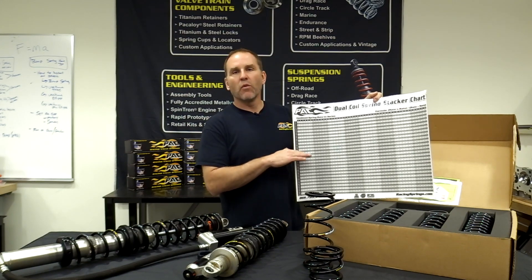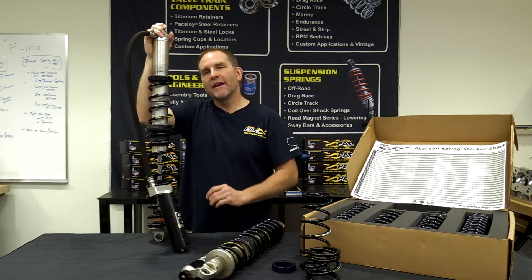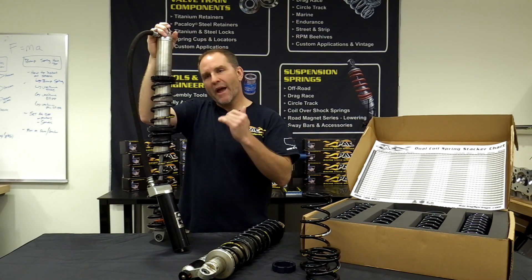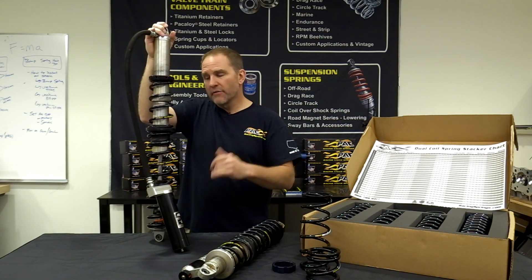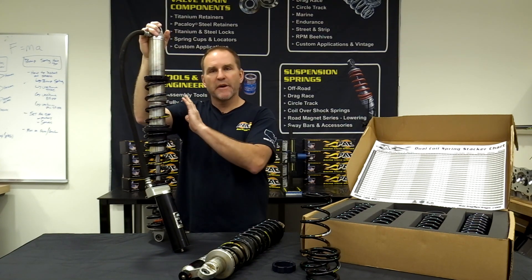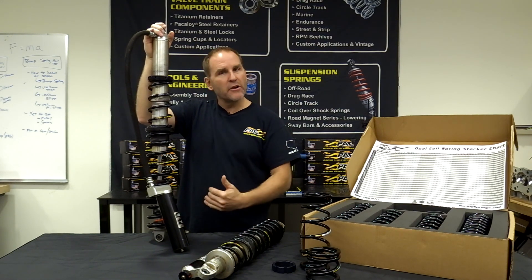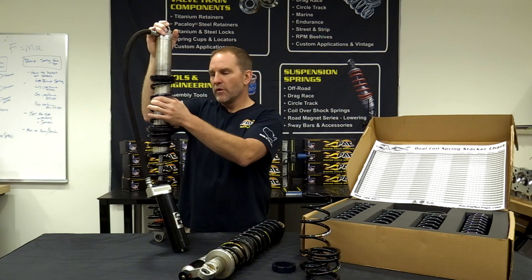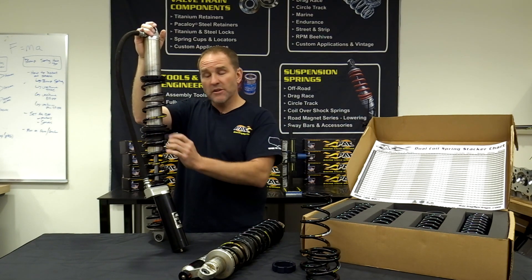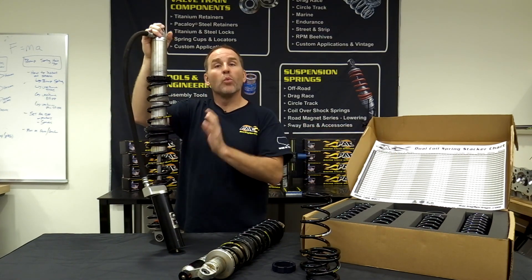It'll explain what your spring rate is, and it's so much softer than a stock spring — it just makes the ride quality a hundred percent better. This is the optimal spring setup for your UTV if you're looking for that wonderful ride quality where you're cruising along, but yet you have the spring there when you get into the harsh stuff. With the lockout ring, the slider, and the dual rate setup, you can set this suspension infinitely adjusted for your weight load, the riding you're doing, the speed, and the terrain. All you do is adjust the lockout ring to where it contacts the slider on the main spring and get you into the harder spring rate, so you're not riding around on that 120 pound spring rate when you're in the hard stuff.